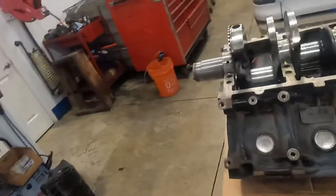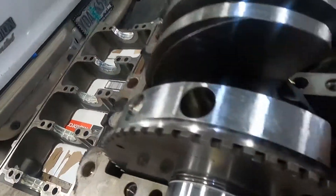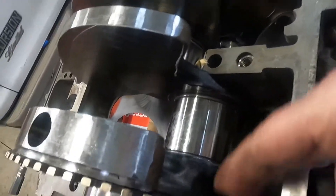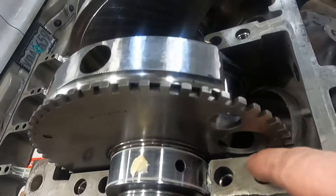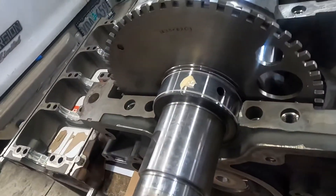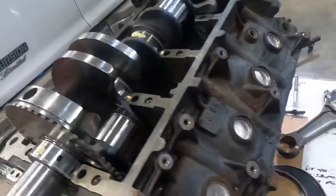We need to talk about this tone ring up here — be really careful and mindful of it. Don't lay this crankshaft down. If you're storing it, stand it up or lean it against something. Don't lay it down on this ring and be really careful when putting it in — make sure everything's lined up as you set it down. If you bend it, especially on the side where there's no back support at this crank throw on the front, it's going to rub on the inside of the block and come loose. If it comes loose, it's going to run terribly and you'll need a crankshaft because there's really no way to fix that.